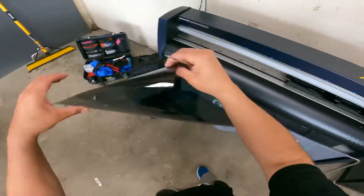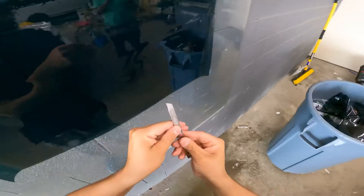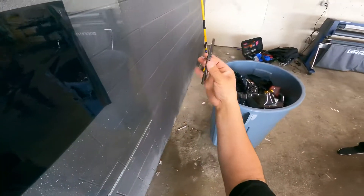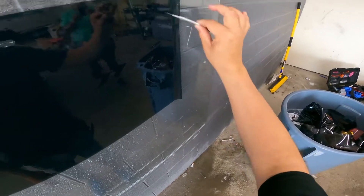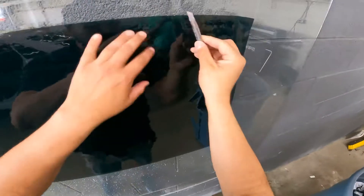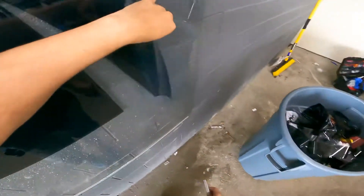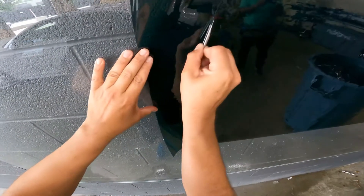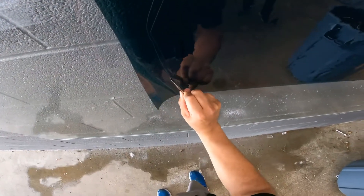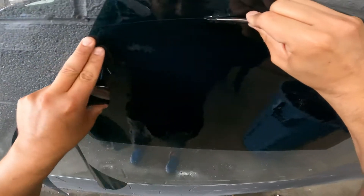When you're cutting, you want two to three lines out, and you're gonna pinch like this — thumb and index pinch — and you want to use as much force as you're opening up a door. This is fresh glass. You can tell it's cutting very smooth.